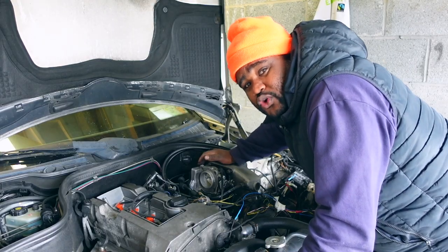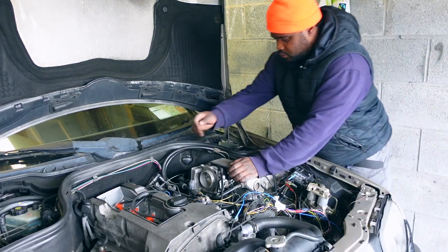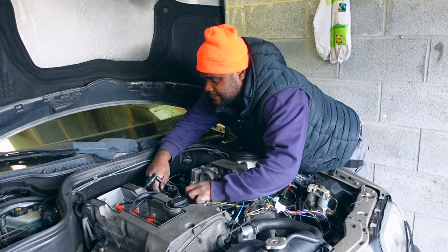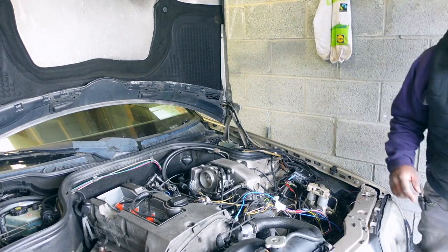She does start indeed. It's idling a bit too high — must be some secondary air coming in from somewhere, some leakage on the throttle probably, since this is a new development. Let me just reduce the idle a bit and see if I can tighten this — 13 mils.